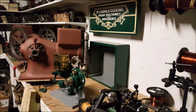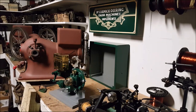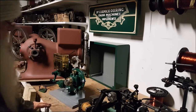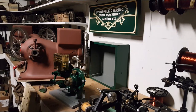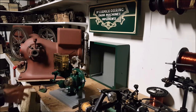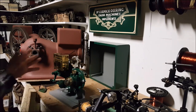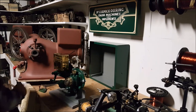It's worth the pause, you know — got a little blues in the background there. When you're watching one of my videos, there, be advised. Now what's gonna happen is I'm gonna put this in that crankshaft right there and spin that crankshaft as if the engine was running, and we're going to observe the spark up here at the test plug.